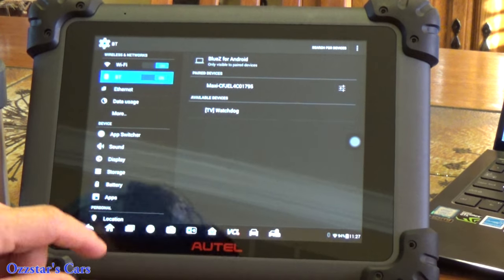What you need is the laptop and the nastf.com site — NASTF stands for National Automotive Service Task Force. That's a free site. On the left side there'll be a column of tabs — go to OEM Programming, find your manufacturer like Hyundai, and it'll give you a link to the OEM site. From there you purchase access to that software. Most OEMs do this. On average it's around $50 — sometimes it's per VIN, sometimes it's a 48-hour access where you can download as much software as you want.